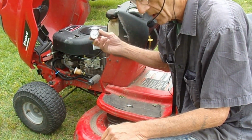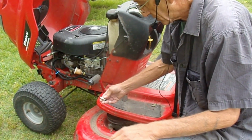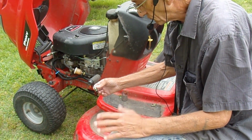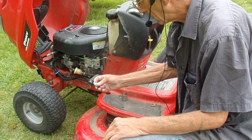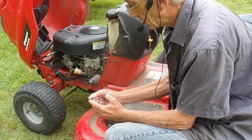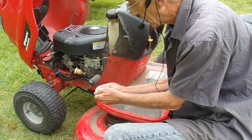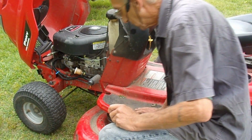There wasn't any information on it, but it did say an air horn. Now what I did do was replace it with this manual compression relief. I think it's from Husqvarna chainsaws. It's under $10. And so I used a 1/8 pipe nipple and screwed it in. So what you do is you push it in, and it allows the compression to relieve, and as the pressure goes, it'll shut it. So I'm going to show you how this works, and we'll see what happens here.